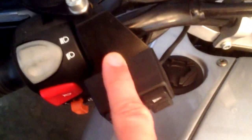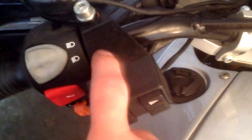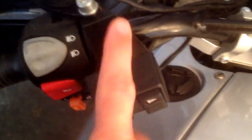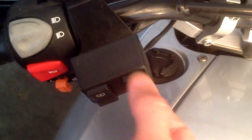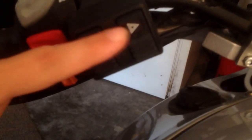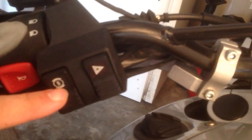There's this little bracket here and this housing. I forget the model number, but it is a bracket for the police model of this bike for their extra switches. And the switch housing is exactly the same. These are the original switches that were in the other bracket. All you have to do is disconnect them — you do have to lengthen the wires a little bit. Then this mounts on the mirror post, and it just fits right under the mirror post.